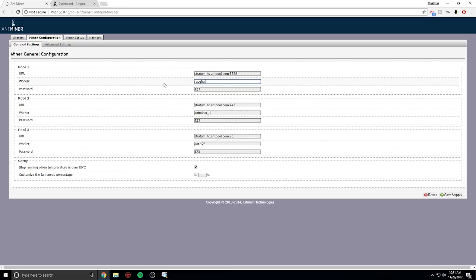It mines about 503 to 504 mega hashes, which matches the advertised speed, and it's only putting up 800 watts — very low for this kind of miner. It will heat up a room much less than a regular Antminer, so heat management from your location will be easier with this machine.